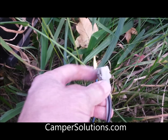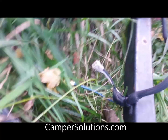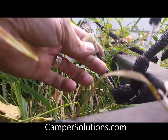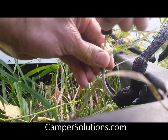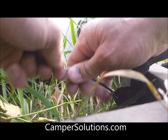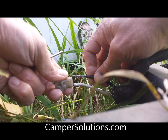It has the pins in it. It's a '97, and the pins are actually in just fine condition. But if you need to separate it, this one takes a special tool. This is a pin-removing tool — if you know somebody who works in electronics, they will have this. All it does is you stick it over the pin, and you'll see that it pushes the plunger up and pushes that out. Here comes the pin on this one. You can clean it up, then make sure the locking tabs are clear, and reinsert it all the way.